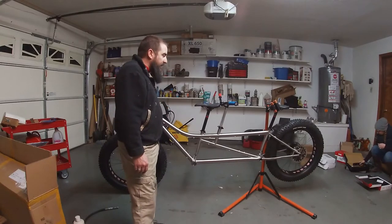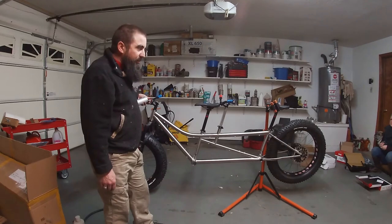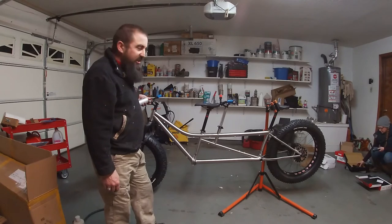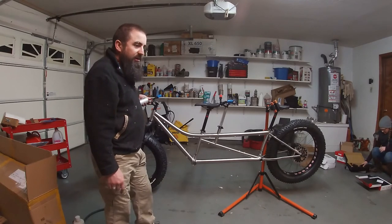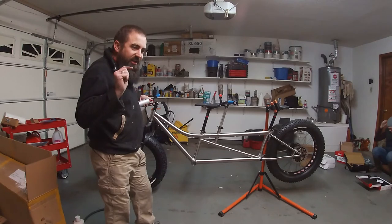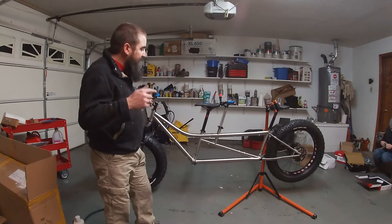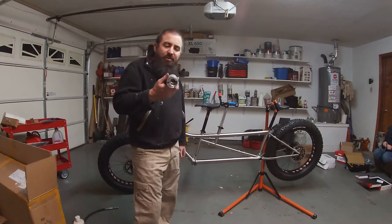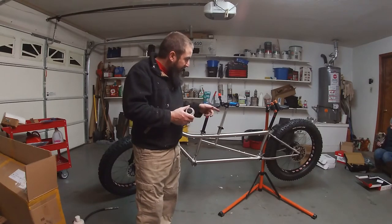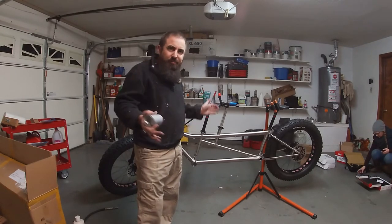We left you for a little while. Hopefully it looks more like a bike now. We installed seat posts and saddles. We set the tires up tubeless — the sealant isn't in yet, but we have the Murica tape, followed by tubeless tape, and then vinyl rim strips, which you can view in another video linked in the info section below. This piece is an eccentric bottom bracket going in the front at 54mm so we can adjust the timing chain. The rear accepts a regular English thread bottom bracket that is 100mm wide, which is kind of becoming the fat bike standard.